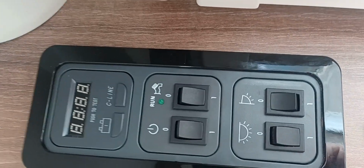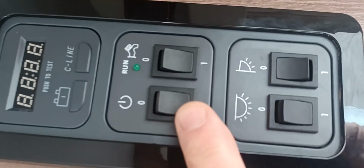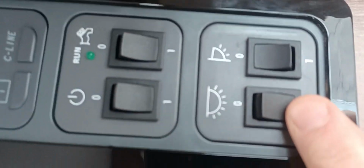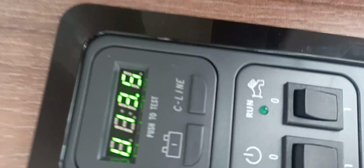On the right hand side when you come into the caravan, we have the control unit here. So this switch here down brings the power into the caravan. Next to it is the water pump to bring water from the Aquaroll into the caravan. That sends power to all the lights, which they have individual switches for, and that's the awning light on the exterior. And you can press and have a battery test and check there. So healthy 13.5. I put you a 100 amp battery, actually out of a 2022 caravan, so it's all good and charged perfectly, ready to go.